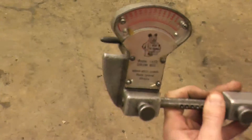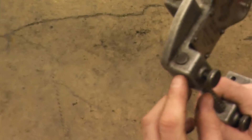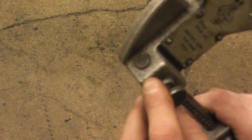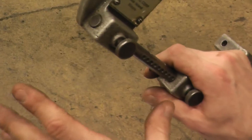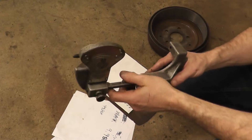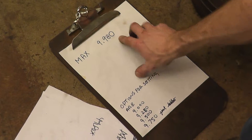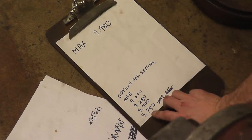If that part has been moved, our measurements will be wrong. So we make sure that it has not moved away from the chamfer position. If it has, readjust it. Since we chose the number below our maximum — this one is 9.980 — we chose the 9.750.